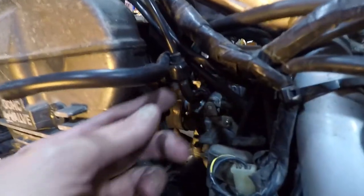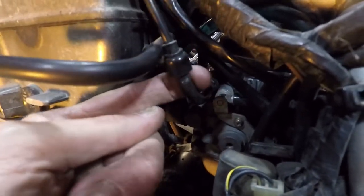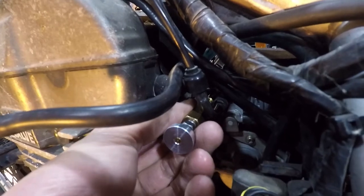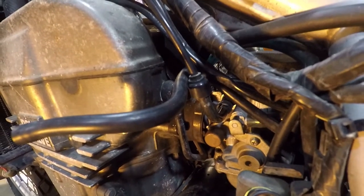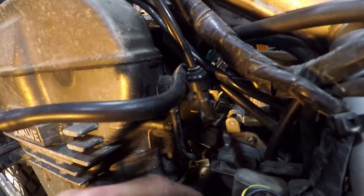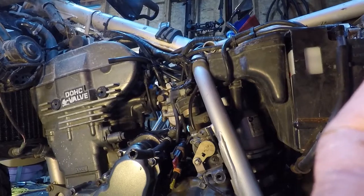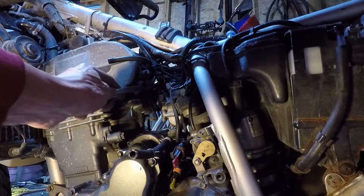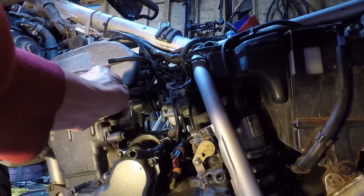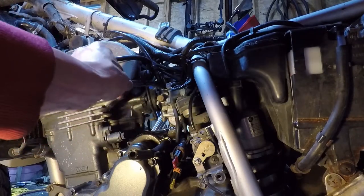Okay, tank's off. You can see what I'm dealing with here — this is the elbow for the enricher cable, and you have to pull it out manually. The bike starts easily like that, but it's a pain, so I thought we'd see if we can thread the new one in and the knob will be easier to deal with. Hopefully we don't have to take the carburetor off, because there's a plastic nut that anchors the assembly in there. I did have it out before and hopefully didn't over-tighten it, so we can just unthread it without pulling the carb. It looks like a 12-millimeter wrench, and I think I left it loose enough to get in there. I've seen fellows also do it with curved needle-nose pliers.